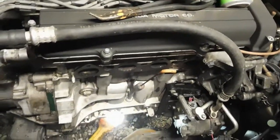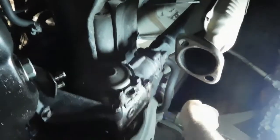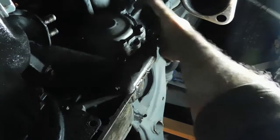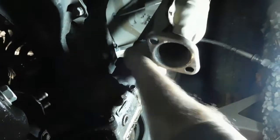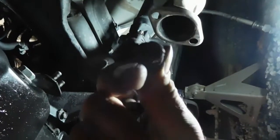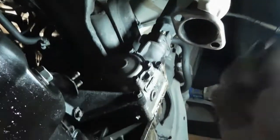So I'm going to first put the drive shaft bolts in. Here's the drive shaft, and I already put it in neutral, so I was able to spin this around, and well, now it's all lined up. So I'll just throw the 4 bolts in, and you can't get them mixed up because they're that 12-point bolt. So I'll get this all put together.